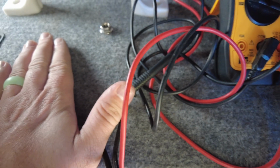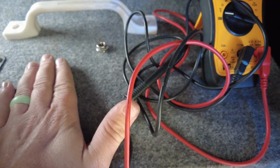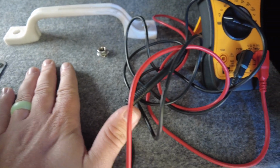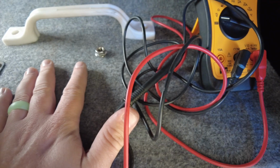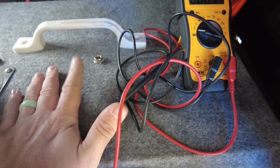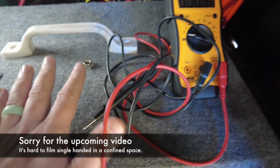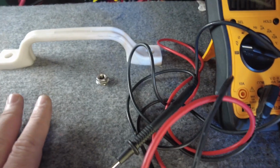Okay, here we are in our battery compartment. And I just want to go over a couple parts of our battery compartment for everybody, just so you know what we're looking at. Right down here, this is where our batteries are. We have 6-volt batteries. We got 4 of them, 2 each in series to give us 12 volts to run the system, since it's a 12-volt coach. And then those 2 sets of 2 batteries run in parallel to give us more amperage. Each of the batteries are 225 amp hours. So we have 450 amp hours of batteries at 12 volts. So that's just basic electronics.